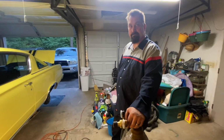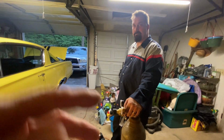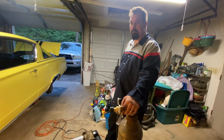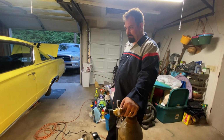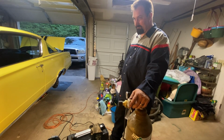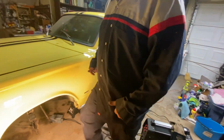And that's something I found out with this conversion to the dual master cylinder and the placement of the lines down along the frame. I've got to come up with a new placement for the split block, because the original single cylinder split block is too close to the exhaust system. Let's open the hood and let's see what you're talking about.